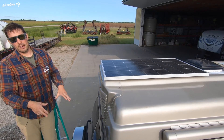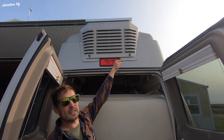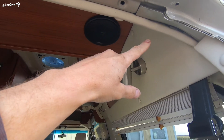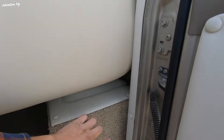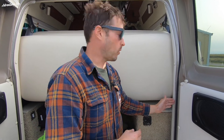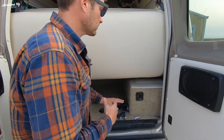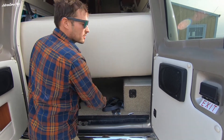If we step back down to the ground, you can see the AC right here and those cables are routed out the side into this cabinet in the corner of the van. After they come through that cabinet, the wires are tucked behind this piece of trim here, as well as this entire piece of trim that goes down the entire side of the van. This trim is only held on with three screws — you can easily pop the caps off, get the screws, and remove the trim. Once I fed it down this back corner, it then goes into this box right here, which contains the water heater and the propane heater for the van. I took the top cover off — just screws — and routed the wires through the entire box all the way to the front, where all the magic happens.